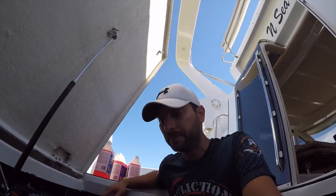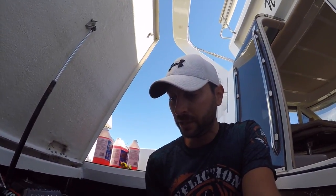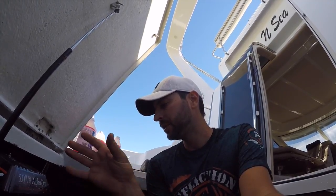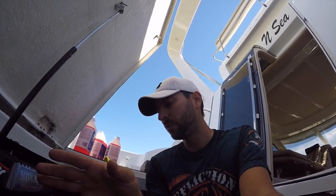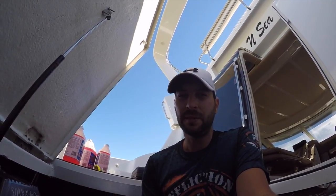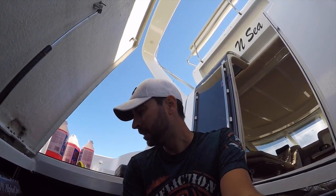Just pulled it out of the water. I haven't done anything to it yet. So the first thing you need to do, if you do it the way some people do, is run antifreeze through the drive. You put the muffs on your drive with the hose, fire up your engine until it warms up so the thermostat's open. After that, you run antifreeze through the whole system, and when it comes out, you test how concentrated it is, so you know that you're good for minus 30, minus 40, whatever it is. I don't like doing it that way, so I'll show you how I do it.